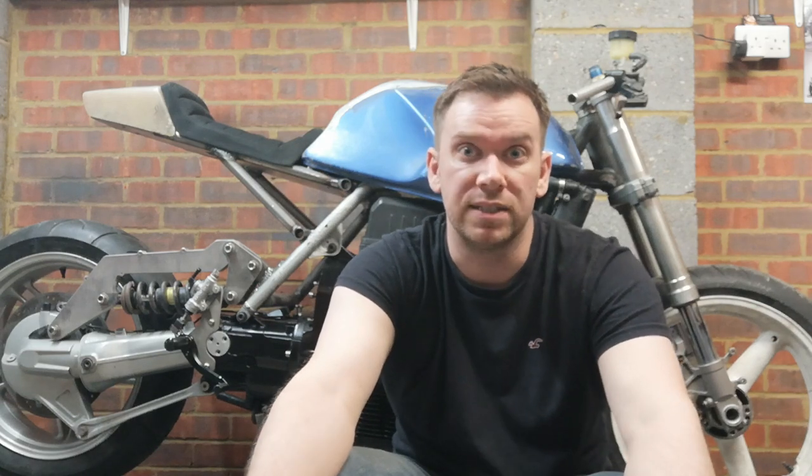Unfortunately, back in July of, I think it was 2018, I was out for a ride and the drive shaft just stripped all of the teeth on the actual drive shaft itself, and the bevel gear was just destroyed. I was having a real hard time trying to find a replacement K100 drive shaft and bevel gear, and what kept coming up was K1100 paralever, and I thought that would be a better option to modernize the bike rather than just replace. So replace and upgrade.